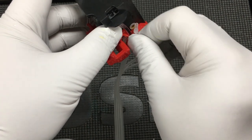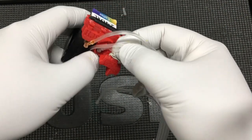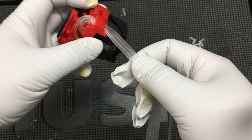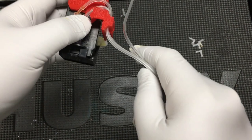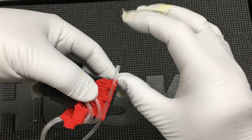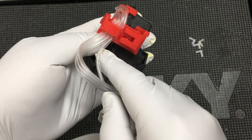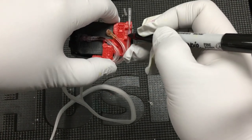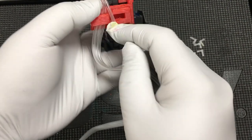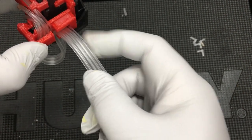Now the yellow. Now this is the black tube. You can run it on top and go through this loop first. We're going to make a twist. Just imagine this one goes to the black. Here is the black cartridge. No matter what you do, the black is always on the bottom. Let me mark it so you can see what I'm seeing. Here's the black tube. When you do the final twist, the black tube is on the bottom.